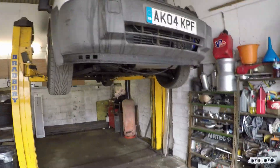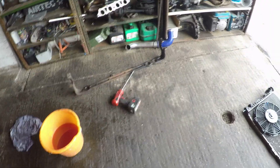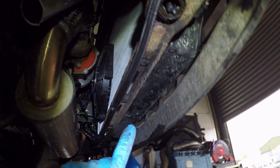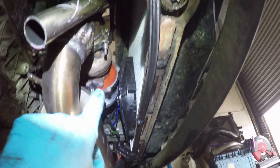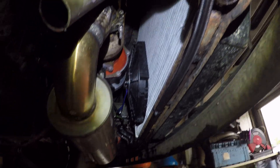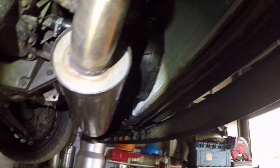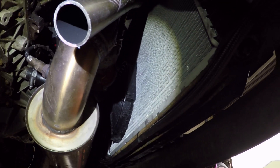I'm going to get the new rad back in. I might try putting the cooling fan on the front and spinning the wires around to give me a bit more room for the boost pipe, since the intercooler was actually mounted off the cross member. I got the new radiator in — I tried putting the fan on the other side but didn't realise how fat the fan actually is. I could have mucked about moving the fan or the cooler forward, but I couldn't be bothered, so I just put the fan back on the back. It's worked there before, so that's how it'll stay.